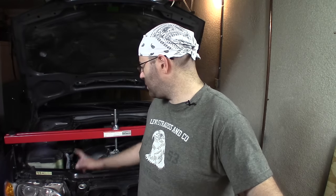The only special tool you need is an engine support brace. It supports the engine from above because you can't support the engine from below with your jack. Normally when you're jacking the engine up from below, you're jacking it up by the oil pan, but of course you need to get the oil pan off, so you can't do that. You need to support it from above. You can get one of these at Harbor Freight for about 68 bucks with the 20% off coupon. It works well, does its job, and was a good buy. You need this tool in order to do this job.